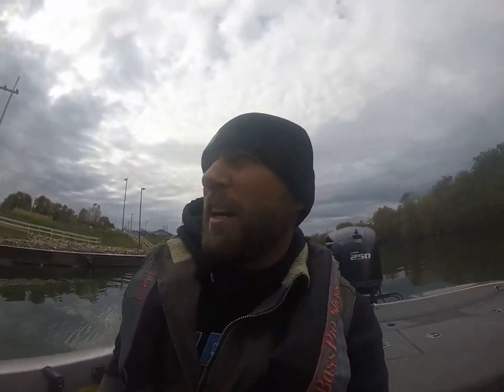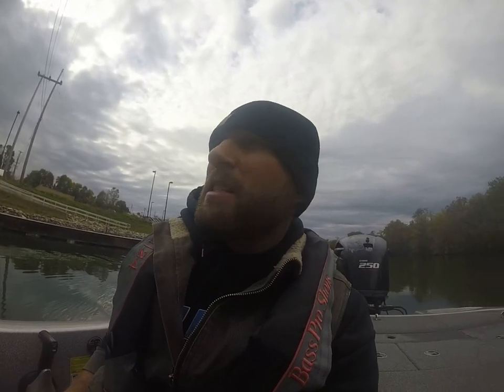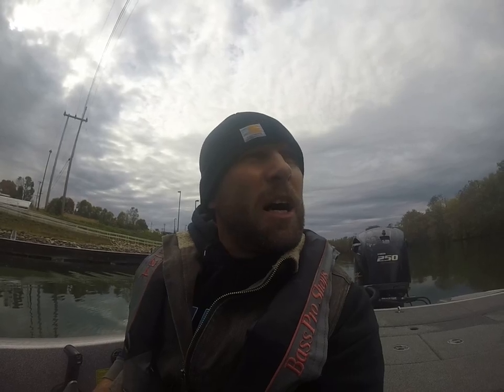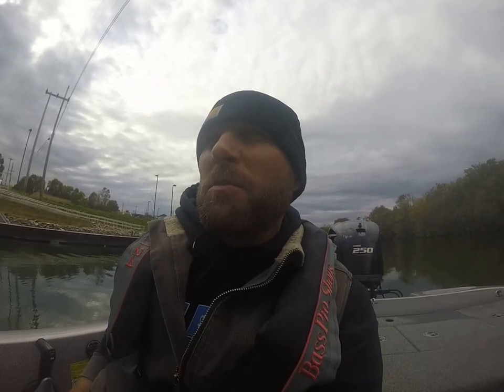We just tried the 25-pitch Powertech VHS, then the second video was a 27 T2 repitch to a 26 pitch by Mark Croxson. He thinned the blades a little bit and balanced it. We saw the results of that — it was a slower hole shot, but we were able to pick up about the same top end speed, but the RPMs were about 150 to 200 RPMs less, so that is my cold water prop.